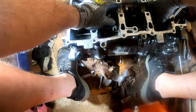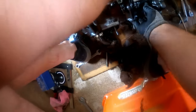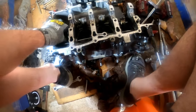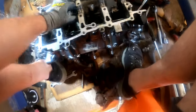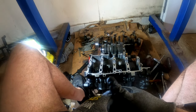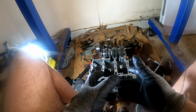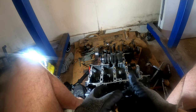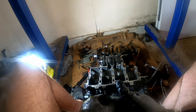The rings — I think the rings came out of this one. Okay, the rings came out of this one as well, but the piston is pretty good. So I bought this bike, the guy said there was a knocking noise and the mechanic said it was the timing chain. Obviously it's not — it's the conrod bearings. Whether they knew that, I don't know, but either way probably the same outcome.